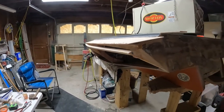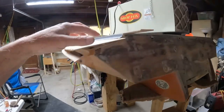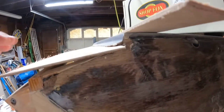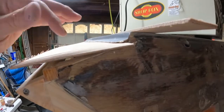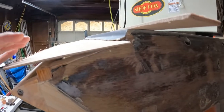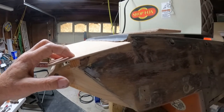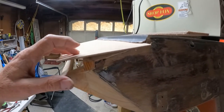I think what I'll do is take the boat off of here and turn it sideways and leave it sitting just like that, so that glue will run in this little trap right here in the slot and stay down in there. Otherwise it's going to keep running out. So I'm going to stand that boat up, sand these down real good with my little DA sander, make fresh wood out of it, and get it ready to apply. I think I'm going to go ahead and put this one on — got to decide if I'm going to clamp it down or go ahead and hit it with a couple of staples. I'll probably just clamp it, but when it's glued in there, it's on. So yeah, I'll probably hit it with a couple of staples. Let's put some plywood down.